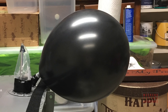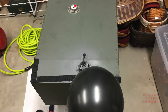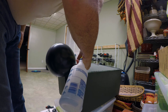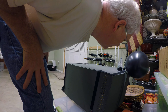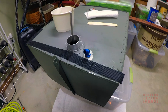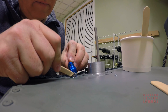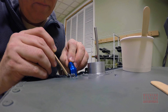I moved the tank down into my basement where it was a bit warmer for the sealant to set up — it takes several days. Then I did the leak test, which is basically putting a few pounds of pressurized air into the tank with a balloon to monitor that. You have to block or seal off all the different openings into the tank for this test, which is really hard to do. I used soapy water to see where any leakage occurs, and I did notice a little bit of leakage at a vent port, but that's at the top of the tank so I was less concerned.